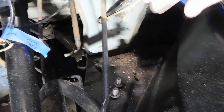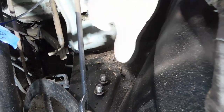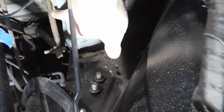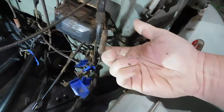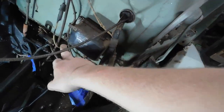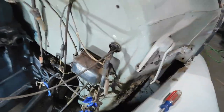So here's something you run into often when you're working on old cars, of course. This hole here is provided for the wiring harness to go to the headlight dimmer switch, which gets mounted up in there through the floor. But we got this extra wire going through the same hole, and that is connected to this fuse holder. These two wires, it's getting hot, it's getting juice off the voltage regulator terminal, going into the cab through this hole,